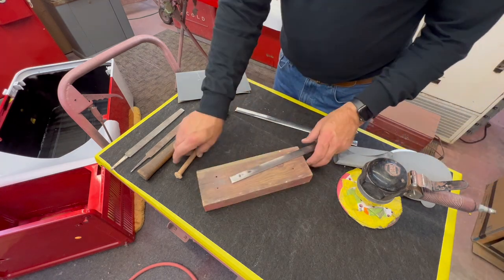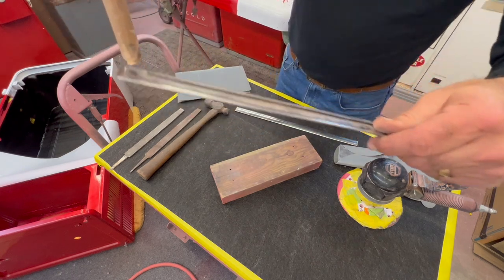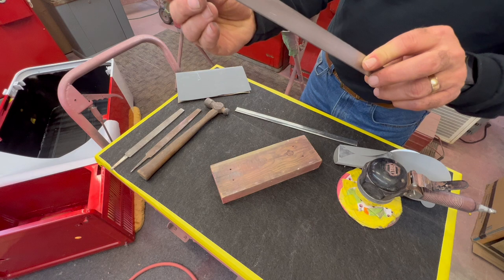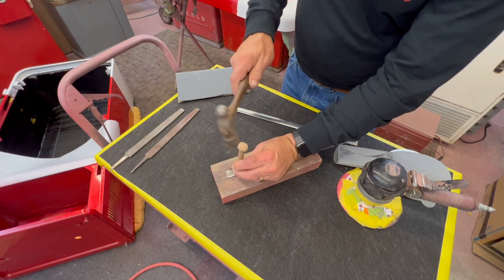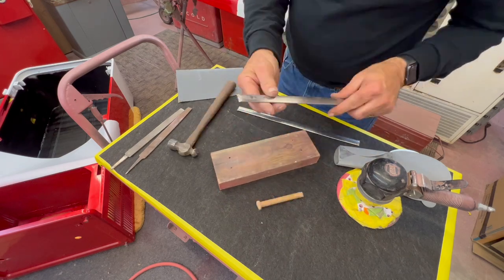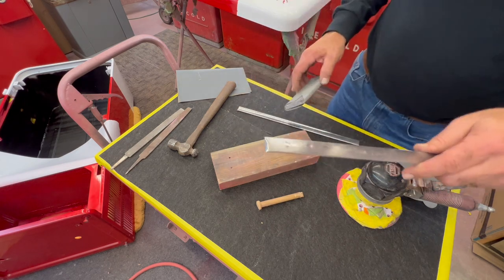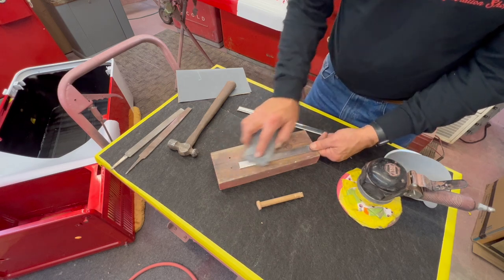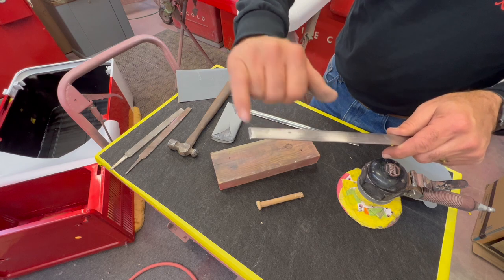So we used our 220 pretty quick. We're going to take a dowel — just a piece of wood. You want to do it on a piece of wood and take this little pin so it will slide through. I've got some little notches cut there so we can get it underneath that trim piece, which on this piece is right in the middle, so it's not going to be too bad. We're going to lightly tap in those areas. Usually you can feel it — I'm a little bit on the high side right now, which is fine. Let's sand it now. Using the same paper, you want to see those starting to disappear. We're getting there — got a little bit there and you can see a little bit of a high spot, but that's not a problem. We'll take care of that.